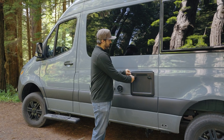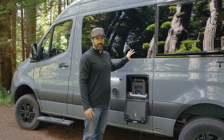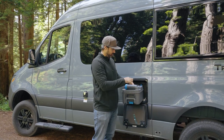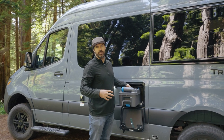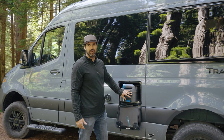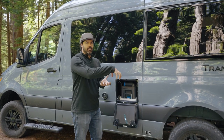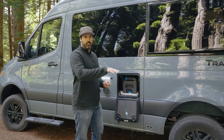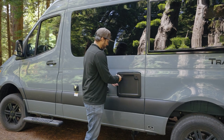Right here you've got your cassette toilet — a 4.5-gallon unit. When you use the restroom inside the van, everything dumps into this cassette. You just pull it out, unscrew the cap, and dump it into port-a-potties or any dump station — no sewage pump needed. I was nervous about this at first, but it's actually very easy and non-messy. It just clicks back in, and a cover plate slides back and forth when you're using the toilet. A really nice, self-contained unit.